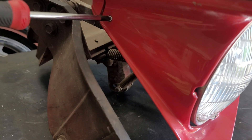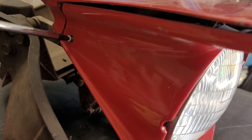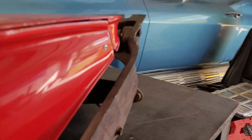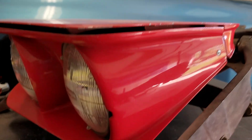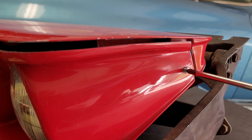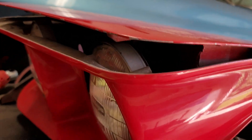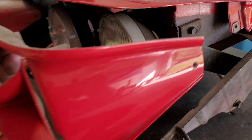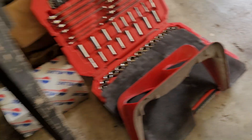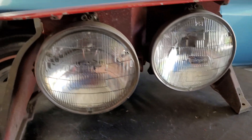So straight up, there are Phillips screws on the side here - they come out, remove this, and this thing is heavy too. It probably weighs a good 20 pounds at least, because the whole thing is made out of metal. These early units have no fiberglass to them at all. Two of those bolts are already out, so we take that out of there and there comes our bezel - out of the way. You can see that's in good shape; I want to set that to the side because this is a nice headlight assembly.